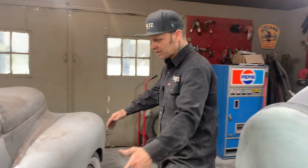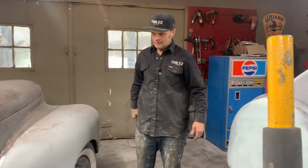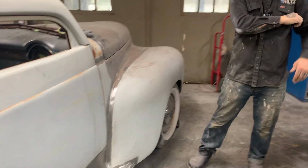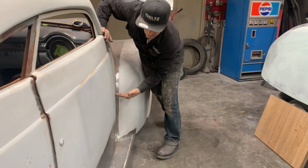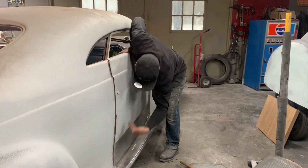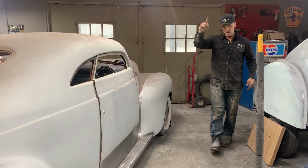If I have to hit it on the outside, I'll hit it easy. I don't like hitting things with a hammer. It dents things up. And right here, where it's rolled in like that, what a nice place to put a coat of glass to start with, and then Bondo right over top of it. To get this piece, I'll probably flood it from here down, do the whole thing, and I'll stop when I hit the ocean floor. And the ocean floor is that metal.